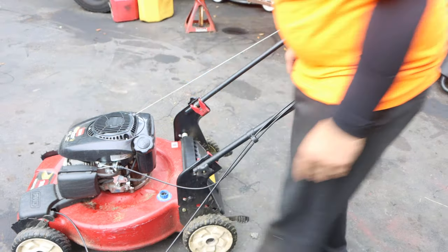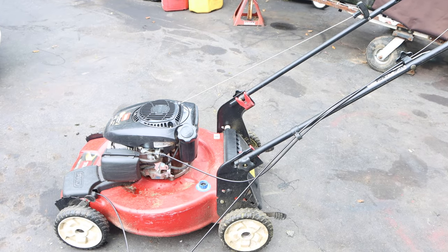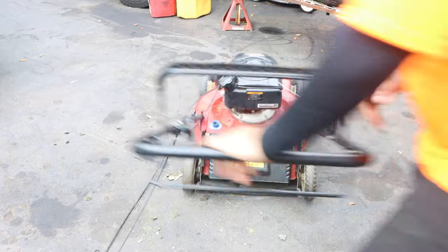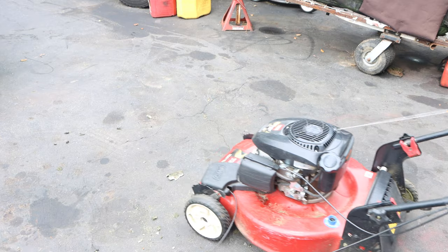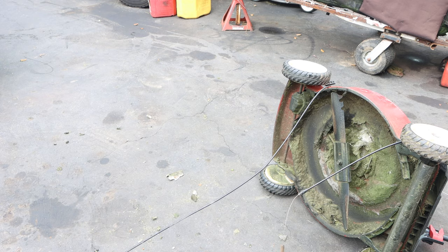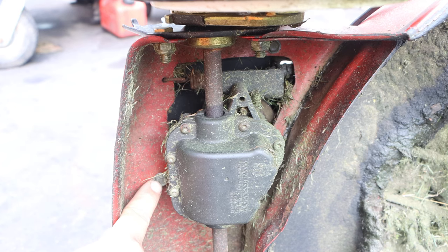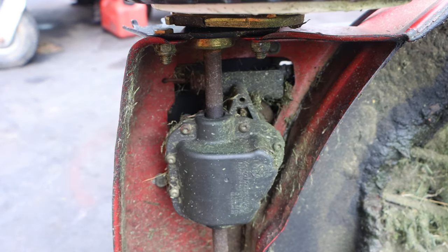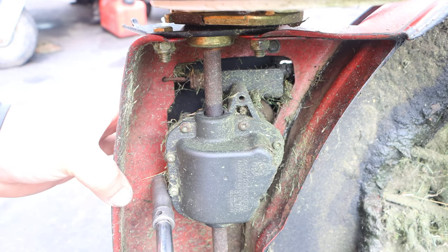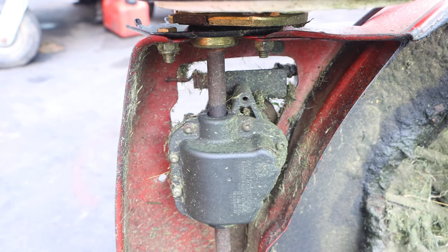Under and hang it right there. Now we're going to have to turn the lawnmower on its side. Remember: muffler side facing up to the sky, air filter side down on the ground. Up and over. Now we're going to expose the bolts to remove the cover. Since we have it on its side, we can access these two 3/8 bolts — one is right here, and then we have another one right up top over there. Nice and easy. When it comes out, set that aside, then do the top, and the cover comes right off.